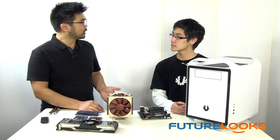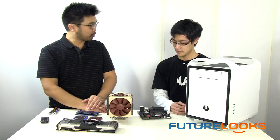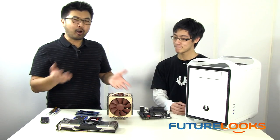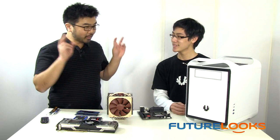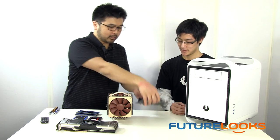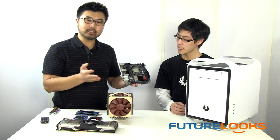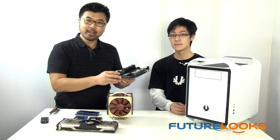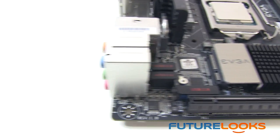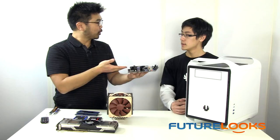You can pretty much say that it's a no-compromise LAN party chassis in a Mini-ITX form factor. I'm going to challenge you with some hardware I've selected to prove that no-compromise claim. I've started out by picking the Z77 Stinger — a board from EVGA that uses the Z77 chipset. It has a 7+1 phase PWM so you can overclock it, a full-size PCIe 3.0 slot for graphics cards, and an Intel gigabit NIC — no compromise for LAN party gaming.